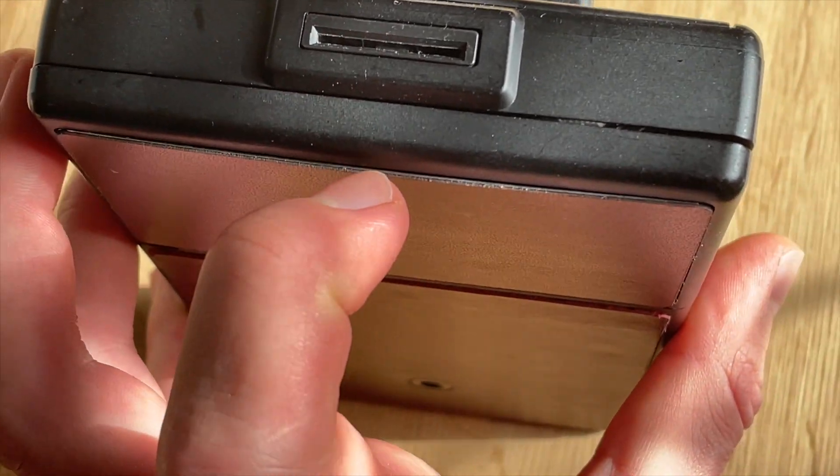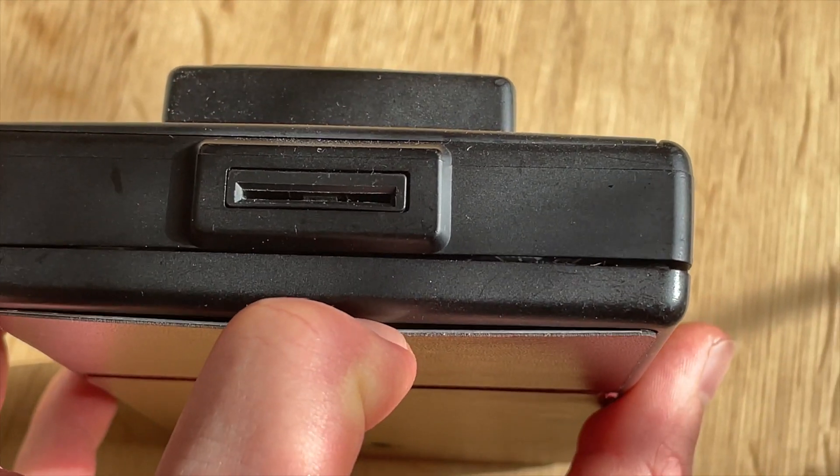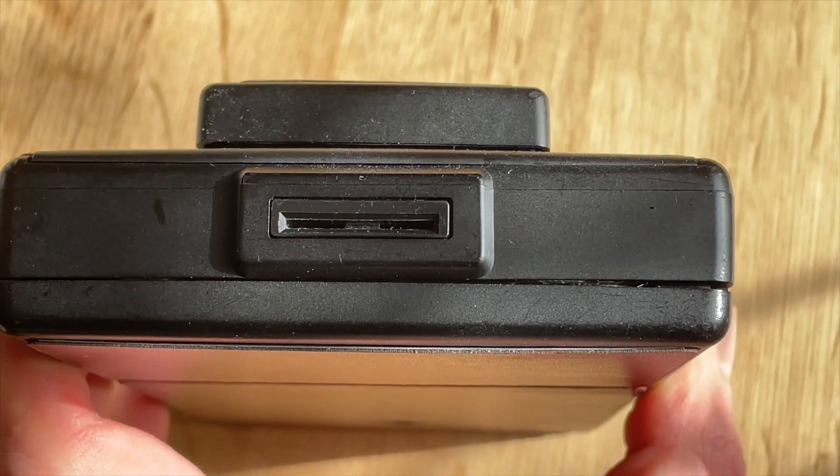Step one: remove the leather from the camera. On my camera the leather was looking really bad and therefore it didn't actually need a pry tool, but the pry tool definitely helped scraping it off a little better. Using plastic gave me peace of mind because plastic on plastic can't do a lot of damage. There are two points where you should be careful: one is the eyepiece — stabilize that with a second hand — and also be careful on the bottom upper side where the picture comes out. There's a little thin metal plate and if you apply pressure from the top you risk bending it, which will ruin the camera. So only scratch from the bottom up and you should be good.